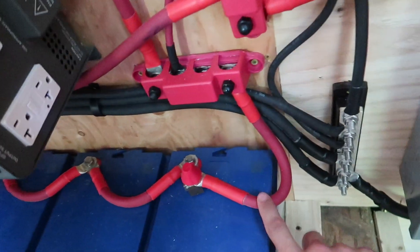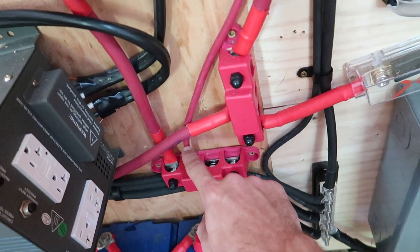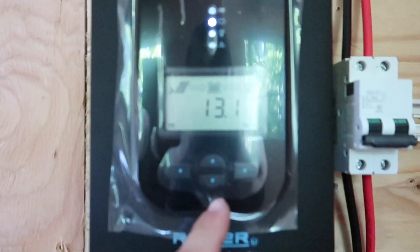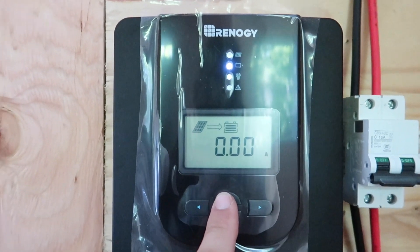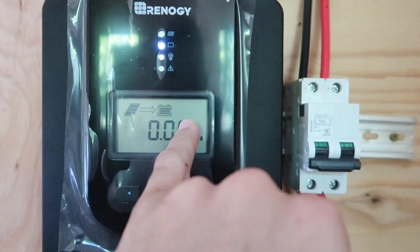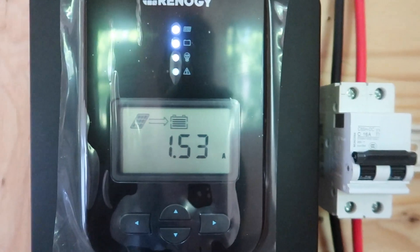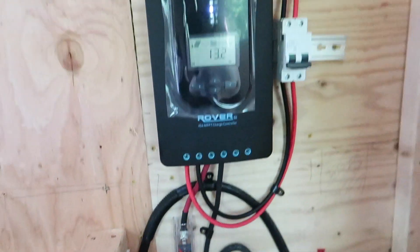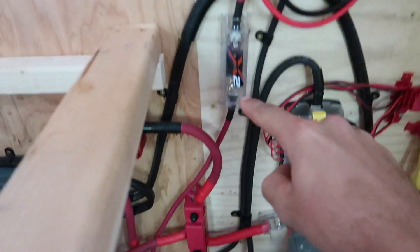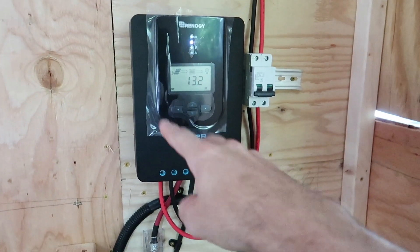On the positive side, we have this 2.0 wire coming to the positive bus bar. Then this 6-gauge wire goes from the positive bus bar through a fuse to the charge controller. This charge controller is pretty fancy — it has all these settings. I have it turned off and it's pulling no power from the solar panels to the battery. If I flick it on, there's a bit of a delay. We're parked in the shade and it's pulling in 1.5 amps right now. One thing to never do: never connect your solar panels to your charge controller without your charge controller being connected to the batteries, because you'll blow your charge controller — power is coming in and it's got nowhere to go, so this will blow.